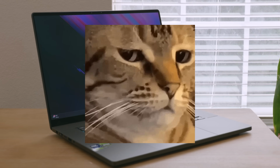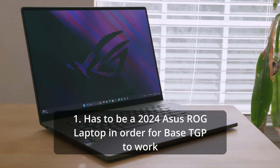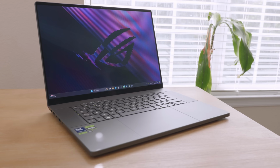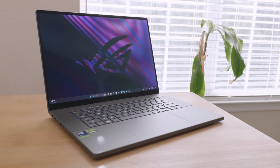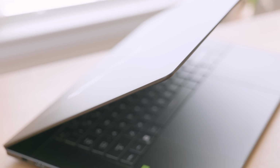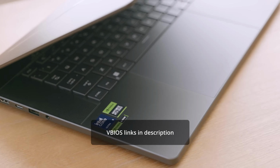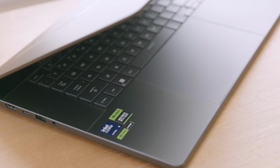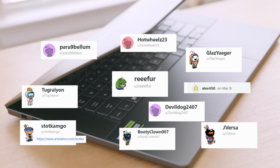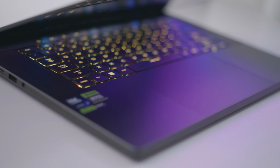But there are only two problems with this. First of all, you have to use a 2024 Asus ROG laptop's Vbios in order for that slider to work. Otherwise, it's going to be pinned at 175 watts and the laptop will crash unless you do some tweaks to the GPU clock limit using ghelper or something. I reached out to like 20 people with the 2024 G16 to get that Vbios, which I'll link in the description for both the 4080 and 4090 in case any of you are crazy enough to try this. I'm also going to give a shout out to those people for helping me out. Here they all are. Keep in mind again, if you're on a 4060 or 4070, there's really no benefit in doing this since they don't scale much beyond 100 watts anyway.